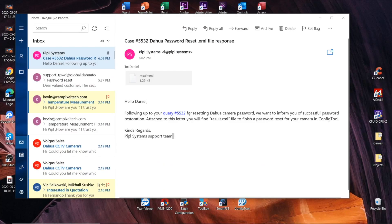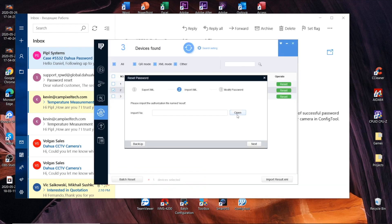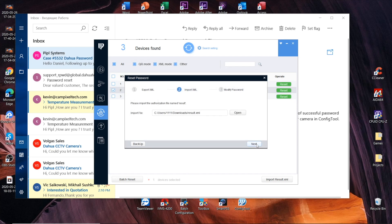Contact your company's technical support by phone or email, briefly describe your situation, and attach the XML file. They usually require you to specify an order ID, your name, and your email address to verify you are the device owner. If that's not an option, contacting Dahua support in your country or the nearest one should work — but only if the camera is certified. You will receive an email with a modified XML file attached. Save it to your computer, go back into the config tool, press Open, locate the file named 'result,' and press Next. Create a new password and replicate it. If done right, you'll see a success message and the pop-up will vanish. Your camera is now restored — activate it again with your new password.